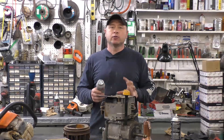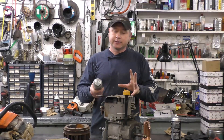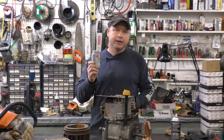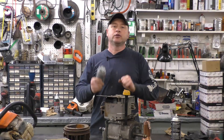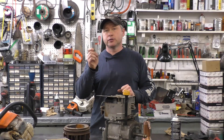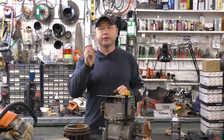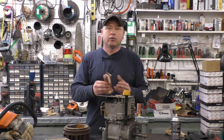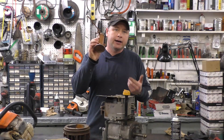I'm going to answer the question right now. Basically, the answer as to whether you should add anti-seize on the crankshaft before you put the flywheel on — it's a big no. Do not put anti-seize on the crankshaft before you reinstall your flywheel, and for that matter, don't even put some oil on there either. You don't want any slippery lubrication on the crankshaft before the flywheel goes back on.